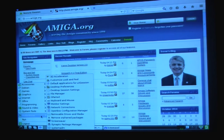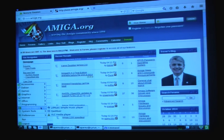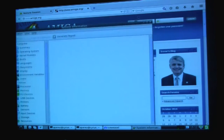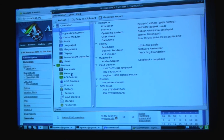My particular machine has 8 gigabytes of RAM, and that's mostly to aid in speed and compilation as we compile things over and over again. If you don't have enough memory, you're really just wasting time. Currently right now in the desktop environment, this is not 3D accelerated at all — that is not working, and it's not working because of a software problem that I actually caused. But this is a full 2D accelerated Radeon 6450. I had SuperTux Kart running in 2D accelerated mode, and even now that is broken because of my tinkering. I need to roll back to a previous instance.